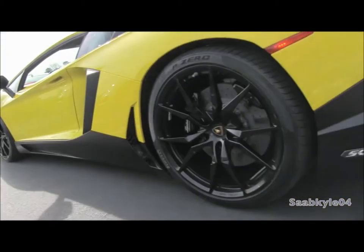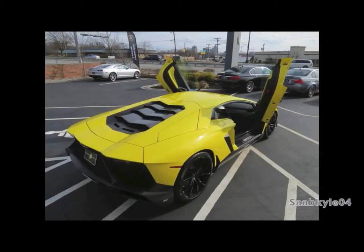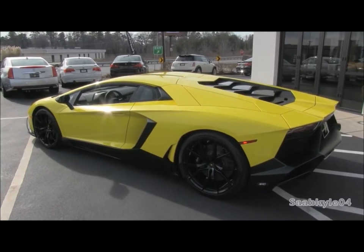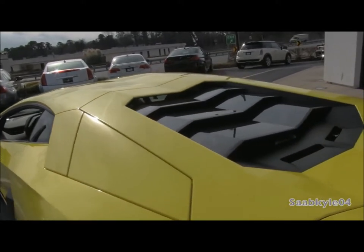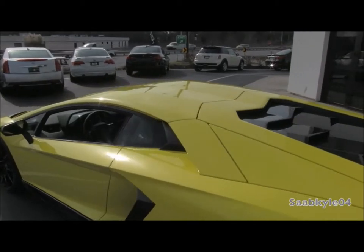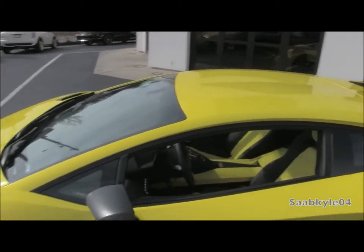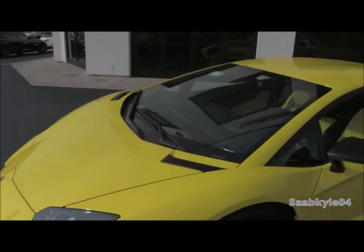All in all, the chassis boasts torsional rigidity of 35,000 newton meters, or 25,815 pound-feet per degree of twist. That's an astonishing improvement of 150% over the chassis stiffness of the Murcielago and weighs just a hair under 325 pounds. Once assembled, the aluminum subframes are then bolted to the front and rear of the monocoque. Aluminum is both lighter and stronger than traditional steel components. By attaching the subframes and crash structures in this manner, it allows for easier replacing and repairing of parts in case of an accident.